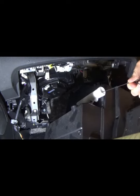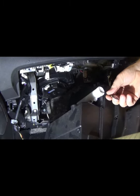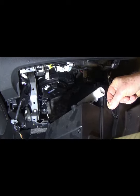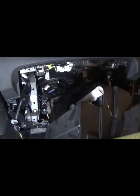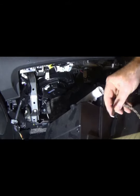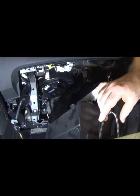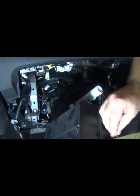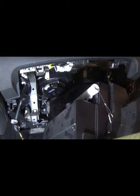This is the retraction cylinder — a spring-loaded device that slows the speed your door opens. It drops down through this hole, but we'll have a hard time reaching it once the glove compartment is back in. So I'm going to run a piece of line through it — in the past I've used a straw, fold it in half, drop it through there. That's all you need to be able to grab it from the bottom and hook it back on its hook later.